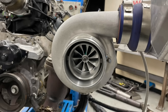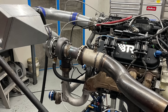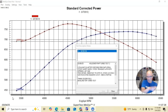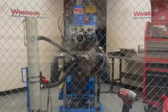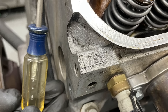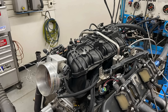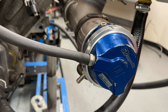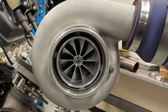Let's jump right into the dyno results of our power cone comparison. We're stepping the exhaust up in size from how it exits the turbo out to a bigger exhaust. The test motor was a 5.3-liter aluminum L33 with about 700 pulls on it, ring gap set, 799 heads, the Richard Holdner Performance low-buck truck camshaft, a Trailblazer SS 92mm throttle body, and our turbo kit.